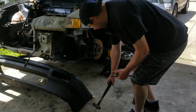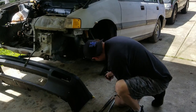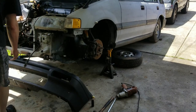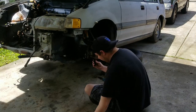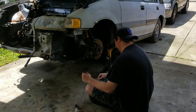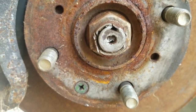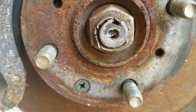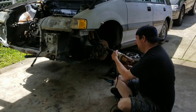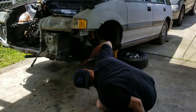All right, we have that. I believe it's a 17 mil at the bottom — yeah, I would say it's a 17 mil. Let's move this bumper out of the way. There's no cotter pin, which is kind of not good. This axle nut is destroyed — check it out, it has definitely been reused quite a few times. The axle nut is a 32 millimeter. Let's get our pickle fork and remove this lower ball joint.